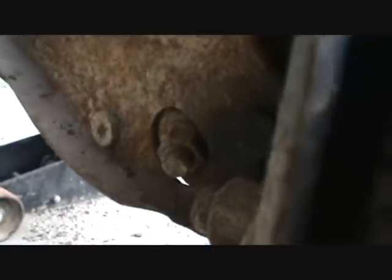These are your strut rods over here — they kind of locate your front end lower arm. I've always had trouble with these because I forget how they come out. There's a nut on the end right there, but they have to go forward — they will not come backwards, that's just the way it is. Take that nut off and take the other nut off and start working it out.